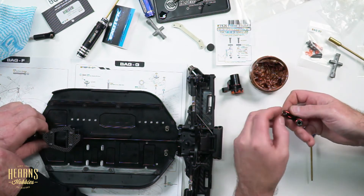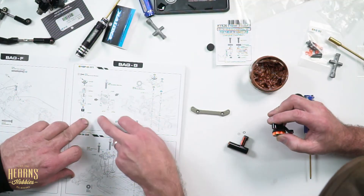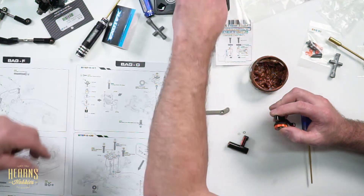I just dropped the screw in the Loctite juice - that's the best bit. And we've got a couple of these really small shims here, which is a case-by-case application. The two posts are lock-tight, they're in. I'm just putting the tiny little bearings in and the crush tube. So, that one goes on the left side and the servo saver goes on the right side - that's where the servo's going to go. Crush tube. Then we've got the Ackermann plate. A lot of people are using the new Truggy Ackermann plate on there - the Ackermann measurement is different.